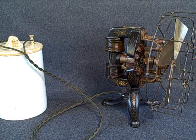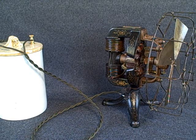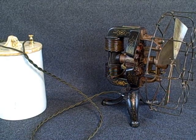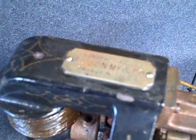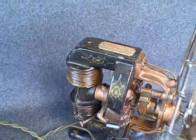The four-blade Edison fan is the most common version. This one is relatively early — it has sleeve bearings rather than ball bearings, so it predates 1898. It also has a nickel-plated brass nameplate with no serial number. This would put the fan somewhere around 1896.